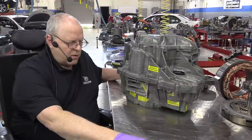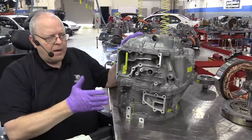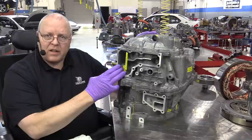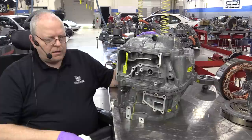The only difference that I'm aware of that I could find is on the Prius V, it has an additional cooling passage right here. On a regular Prius and on the Prius plug-in hybrid, there's no plate that bolts on here and no coolant hoses that hook to it and no additional coolant pump to pump coolant through it to help cool down the MG2 rotor. So on just a regular Prius like this one, these passages are just open. There's no coolant hoses hooked to them at all. But if you look up the component list for a Prius V, you'll see there's a plate with two coolant hose fittings that connects right there. All right, while we're here